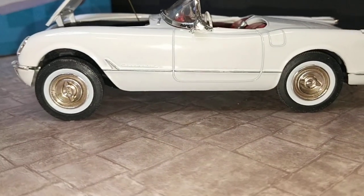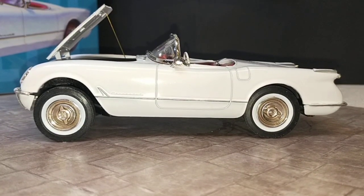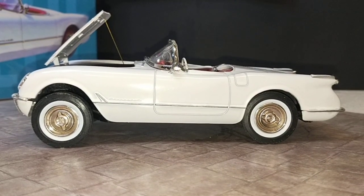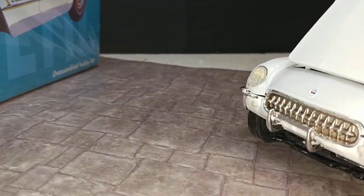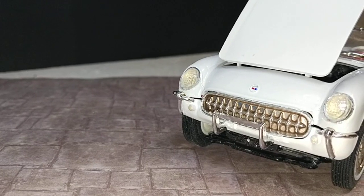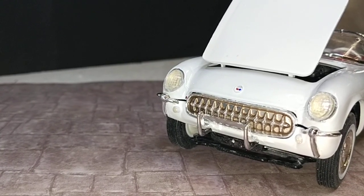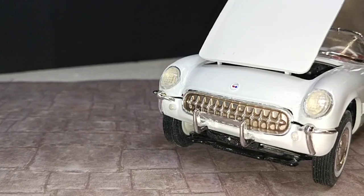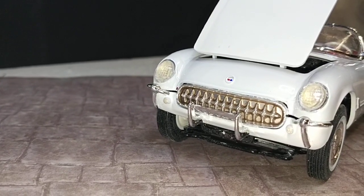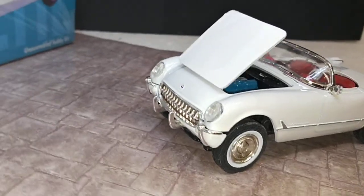One of the problems I found was if I backed back enough, the ride — she sits like a gasser — and no matter what you do at the front end you can't get that to drop down. That was one of the problems. The other problem I found was here in the front where the lower valance meets the upper guards. Once that grill's in place they just don't fit, and I filed both top and bottom and even around the grill and I still couldn't get it to mate up. So anyone building this kit would have to do some pretty aggressive filing to mate that up perfectly. But I'm happy with it — the overriders seem to sort a bit of the problem out.